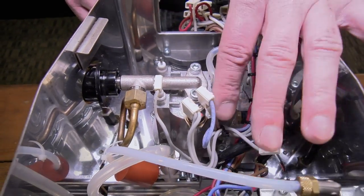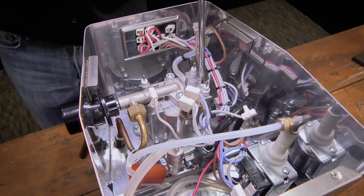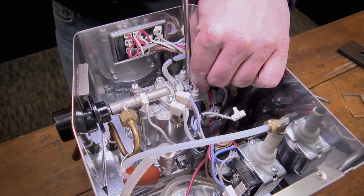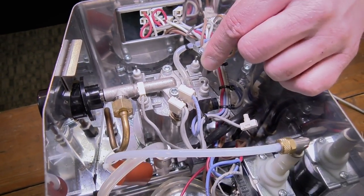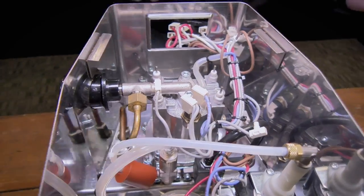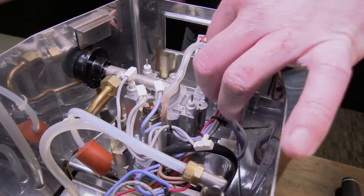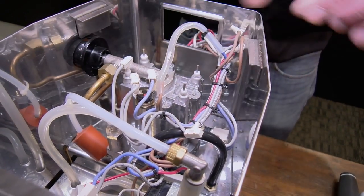This is the bracket that's holding the fuse end — you can see the whole rubber tube. You need the Phillips screwdriver. It can sometimes be a little stiff when you first try to break it loose, but once you do it'll be fine. You can back it out just enough where, as you're pulling up on the clip, you can move it off to the side, or you can just take it completely off. I always tend to not take it all the way and just slide it over to one side. Now that we have the clip off, we can move the fuse around. There's your fuse right here — it's covered with this little rubber tubing. We need to cut the zip ties on this end and some more along the way so we can straighten the wire out and slide the tubing off of the fuse area.